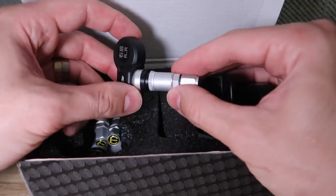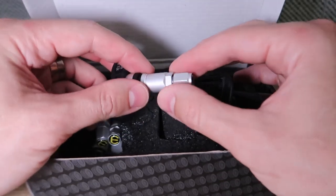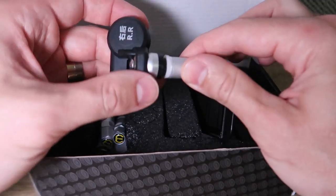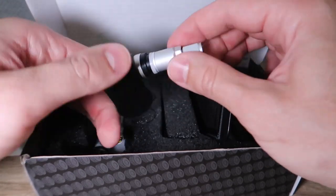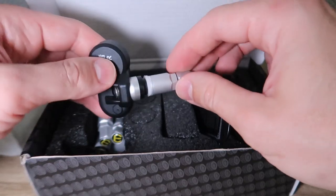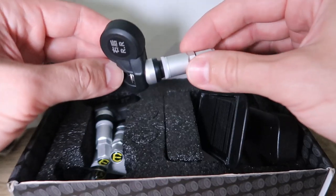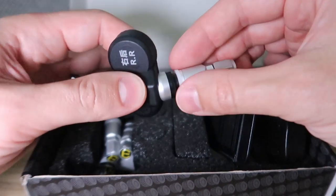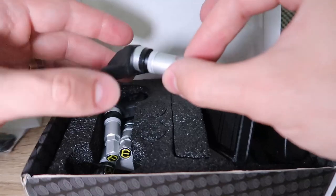The difference with this kit is the sensor - this one goes inside the wheel, so you need to get these installed when you're changing tires. It replaces your actual valve stem. The issue is that the Crown and Supra wheels don't have this style of valve. This would go on something like the X5 wheel where it's not a two or three-piece rim - it just mounts on and sticks out the edge. So this kit will be going on the BMW.